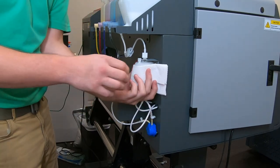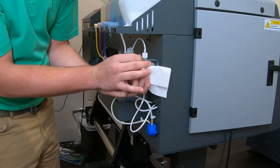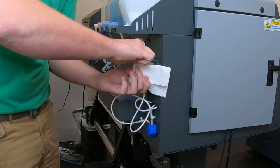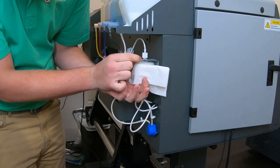Using a paper towel, clasp the filter and carefully unscrew the air valve. Once opened, air pressure will be released and white ink will flow again into the filter. There may be a small spurt of white ink released.